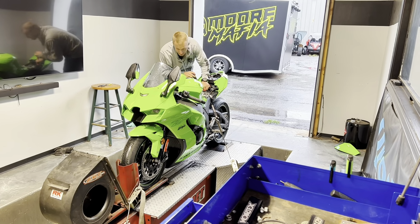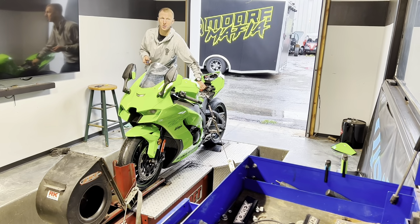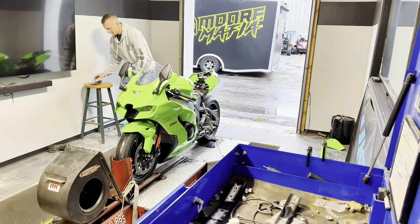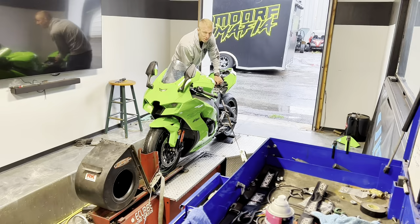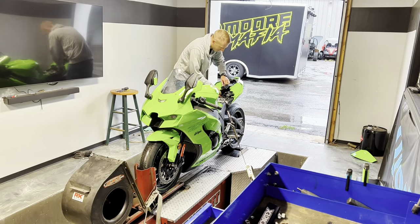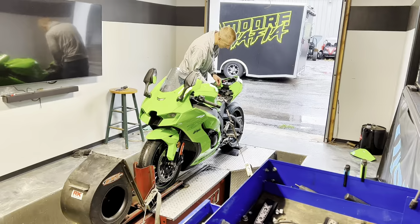Is it gonna be that way after this is done, do you think? Yeah, if we turn the decel fuel cut option on. In other words, I can make it not do it, but it don't ride as smooth. When you say ride as smooth, you mean like coming down off throttle? It'll do this. Not necessarily that. It's more like stock as far as when you barely let off the throttle. It just thumps. Yeah. Gotcha.